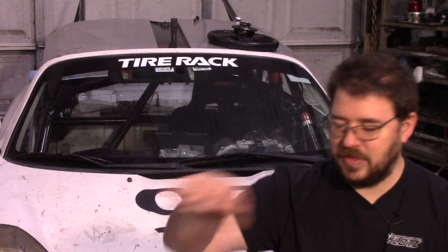For me, I'm not sure what I'm going to do next — I'm not sure if I'm going to pick up a 2AR FXE and do what I just said, or if I'm going to put higher compression pistons in this thing at 12.5:1, just to stay as close to what the other options are as possible, and see how much knock it makes on premium fuel once the cam is moved. And I know what some of you guys are thinking — what about the 2GR FXE? Well, I looked at that thing. I've got cams on the way. The duration on those intake cams is 270 degrees — even bigger than the 2AR's cam. They'll probably end up in the Widowmaker. Either way, there's some potential there for essentially a $200 upgrade to the 2GR — but again, it'll require an aftermarket ECU.